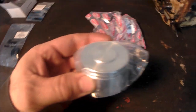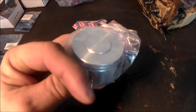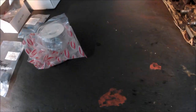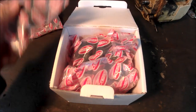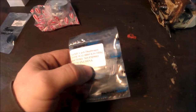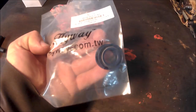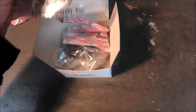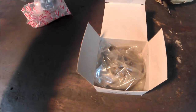Here's the new Cross pop-up piston. You can see how the piston is domed up — usually the piston is flat. This gives you more compression. We'll talk about that more later once I get into the assembly. Then, since there are parts of the piston and the muffler damaged, I got a new muffler. Then a carb kit to rebuild the carb because I'm unsure how long this has been sitting. Then the crank seals.